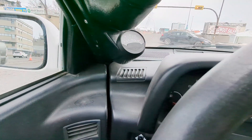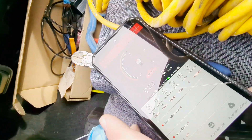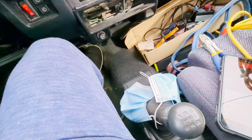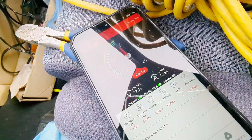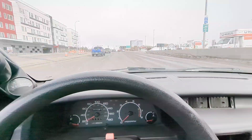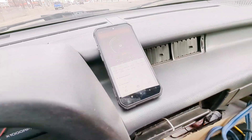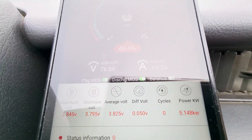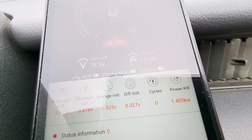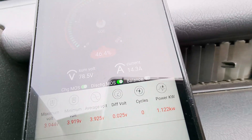Going about 50 kilometers an hour and only drawing 30-some amps — it's really remarkable how little energy this car takes to move. There's the amp meter, and the volt meter is always pegged because it only goes to 60, which is pretty stupid. We're just starting in fourth gear like completely normal people. I really want to try and show the regen — so surprised it works. Current is going positive, charging the battery, slowing down.